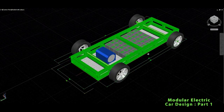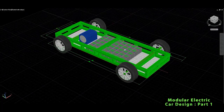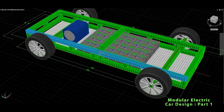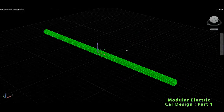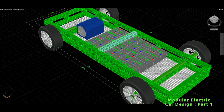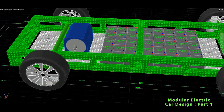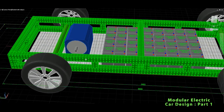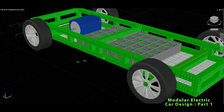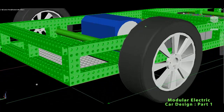Until now I've been dealing only with the chassis of the car. These elements are the Alufix — a German company's aluminum profile elements which you can buy and cut, like Lego. It's very simple to make a structure, especially the structure I designed which could hold the batteries and the whole car. It has many different types of aluminum profiles, so you can choose depending on how strong you need things.